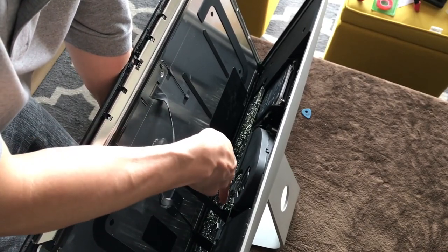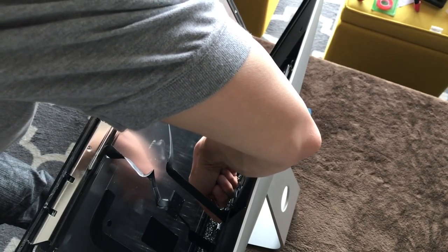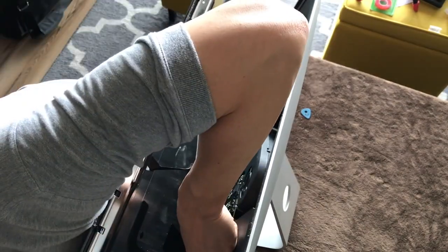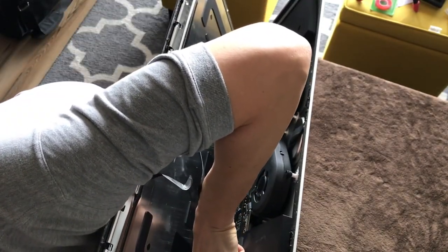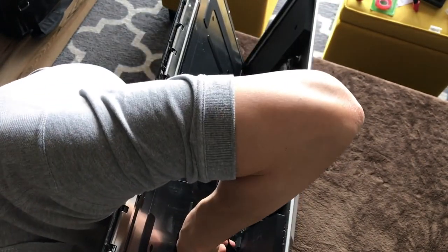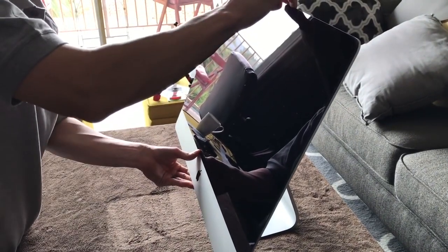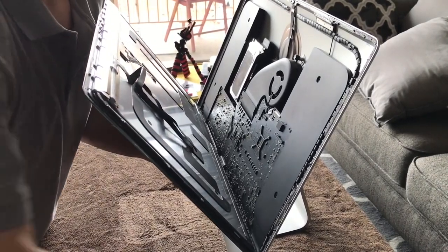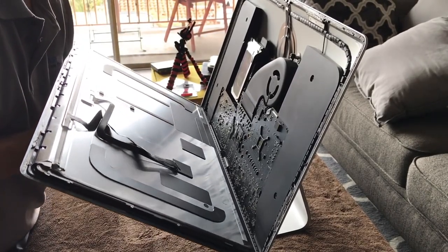Once released, you'll see the power cable and the monitor cable. To disconnect the monitor cable, there's a little black plastic flap — slide your fingernail underneath, flick it up, and it will release immediately. Then pull up gently on the cable. To release the power cable, it's a snugger fit — just pinch the sides and pull up gently. You don't want to separate the cables.